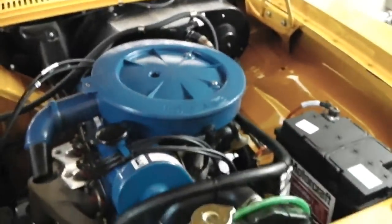It never really went through it, but there could have been a chance that it would eventually have worn through the hose, the bottom rad hose. So I've come off on a rubber elbow, which loops it a lot further under the belts and gives it a handy chance to fit the inline stat. So that's why I've done that. We're going to test it out. It's a hot enough day to just let the car tick over and the fan should kick in.